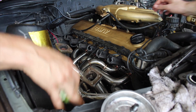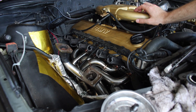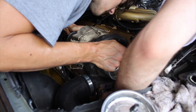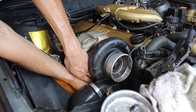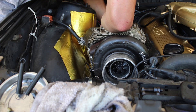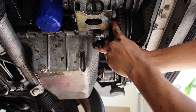With all this done, it's time to do the last part — the oil drain. I just have to mount the turbo and run the oil drain line. The oil drain comes down all the way from the turbo and meets here, so I'm going to trim it off about there.